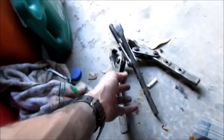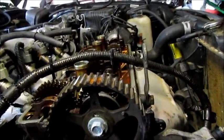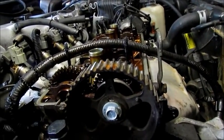That knocked that harmonic balancer right loose. Used my pulley puller right there of awesomeness. Came right off. And now we're just cleaning up. Top dead center, I've already set the crank pulley. The cam, you set it to the K in the up position with the two dots. What size is it? A 10? And so yeah, the Geo of awesomeness.